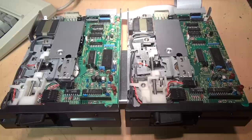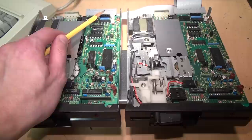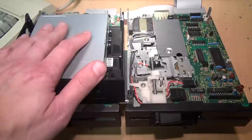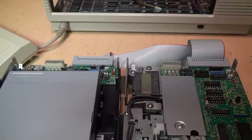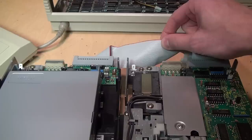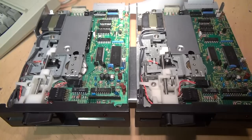You can see this one is set to drive select one, indicating it's the A drive, while the other is set to drive select two, the B drive. Most other manufacturers label the drive select jumpers zero through three instead of one through four. This complicates things when you want to replace one of these drives with a 3.5-inch floppy, because most of those are hardwired for drive select one and cannot be changed. If you think you can just replace this cable with a standard one with the twist in it, that won't work — you'll need to either find an old 3.5-inch drive which does have the drive select jumpers, or just use the modern drive as the B drive.